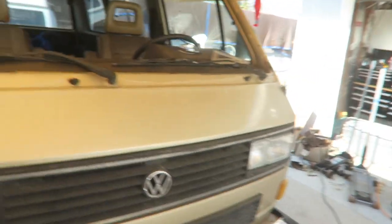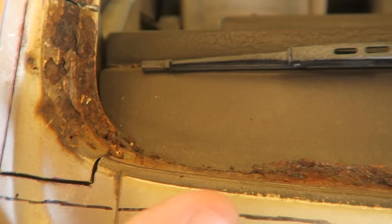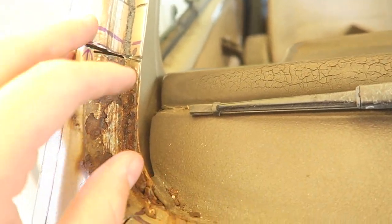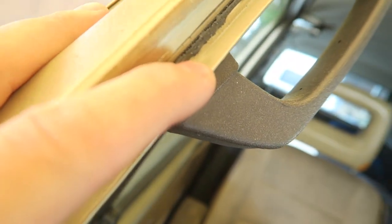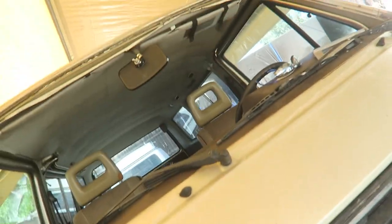We're back home. I just went ahead and busted out the Dremel and cut right here all the way down. There's like a tension on the metal — so when you cut it, it just automatically springs out of place. But as you can see, these little spot welds — this one's pretty visible right here. The best way to get those out, to drill those panels out, is using a finger grinder — or portable belt sanders, something like that. I might have to drop this dash. I'm not looking forward to that at all, because dropping van dashes is not fun. It's kind of like a couple-hour ordeal.